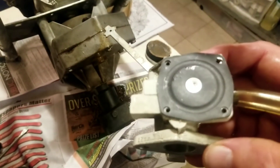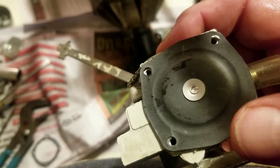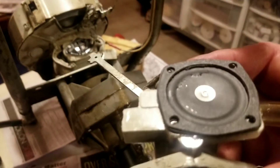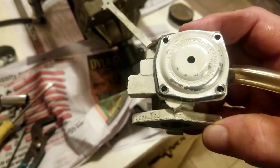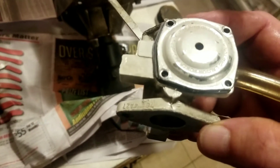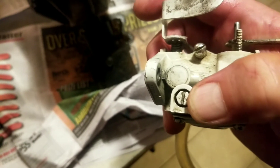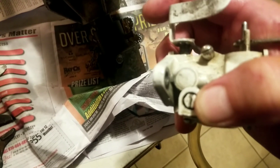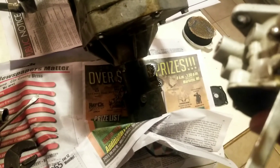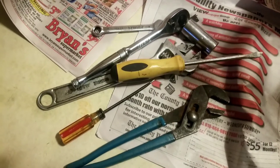Since it's the F-body, we start with the diaphragm, laying it face down with the large silver part and the ridge facing the carburetor body — that ridge goes all the way around and faces up toward the carb. Then the gasket goes on top. Carefully push all four screws into place, align them, and get them started before tightening down. I also removed the main adjustment screw, cleaned it, tightened it gently all the way, then backed it out one and a quarter turns. Finally, the governor spring goes through the front hole of the throttle plate.